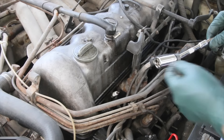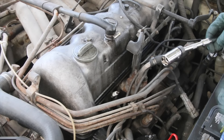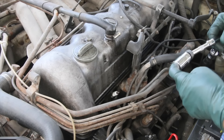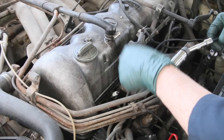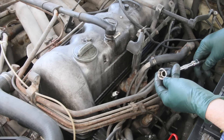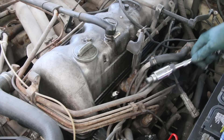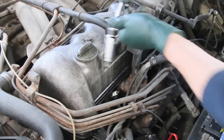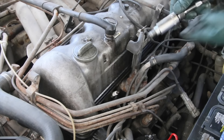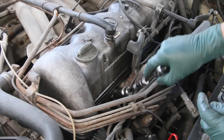To get this plug out, let me demonstrate this new spark plug socket I just got. I've probably used 30 or 40 different spark plug sockets over the years and they can be really frustrating — some are too floppy, some have a rubber piece that rots and falls out, which can let the spark plug drop into the engine. What's nice about this one is it has one of the strongest magnets I've ever found in a spark plug socket. You put the plug in and it's not going to fall out. I like it because it has a nice swivel and that really strong magnet.